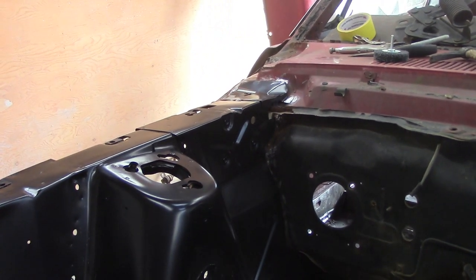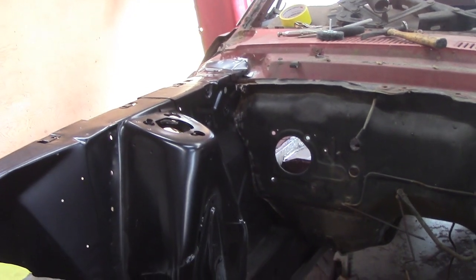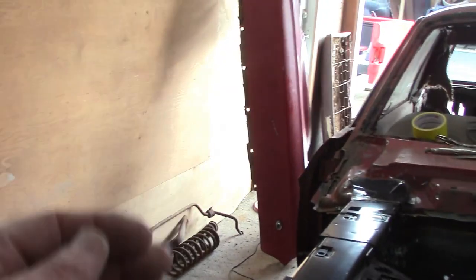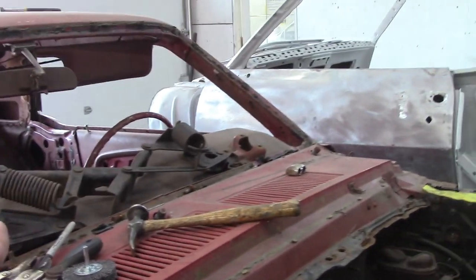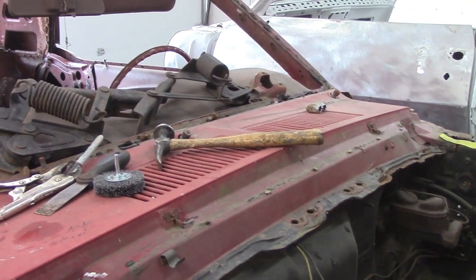Now I've got it closed up and it's turning out good. There's a lot of welding here we've got to get done. But anyway, that's where I'm at right now. So I'm just going to go over and triple check all my measurements one more time, because I've only got around five tacks on this thing. I'm going to triple check them before I get carried away. And I did bring the fender in and set the fender on, and it was lining up beautiful to all the holes, and the gap on the door, and the gap against the cowl up in here. It was lining up with the bolts here — your slide clips — which was giving me room to move. So everything was working out good along here. Now what I want to do next — you can see I've got the hood hinges there — I'd like to get a few more tacks on here on this piece to make it more solid, and then install the hood hinges and just set the hood down on here, because the hood is always a good starting point when you're putting fenders on, in my opinion.